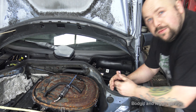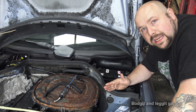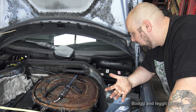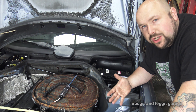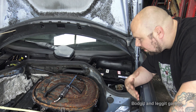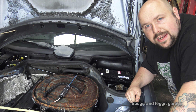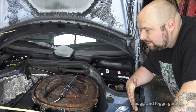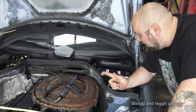This is important: if your battery isn't great or your charging system isn't charging properly while you're driving, turning on the heater, lights, and radio could be drawing the battery down because the charging system can't keep up. The car might still run but it'll be discharging the battery, and when you come to start it next morning there's just not enough power. You might think you have a draw, but not necessarily - so that's why it's important to check first.